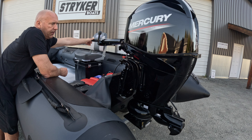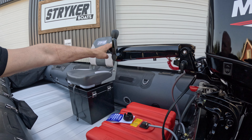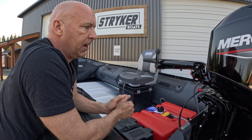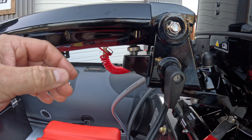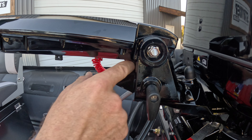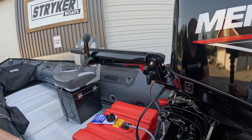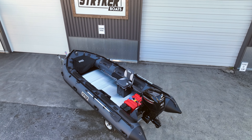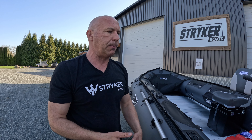You also have trim on the side of the outboard. On the end of the handle there's a troll mode built in — forwards and reverse operate the bucket that this jet is equipped with. You also have a friction steering system and an adjustable position for your handle. You just turn the knob to change where the handle sits, so you can really fine-tune the adjustability for the user. If someone else is going to be operating it, it only takes two seconds to make it comfortable for them.